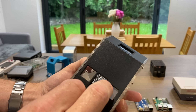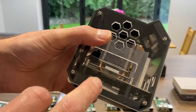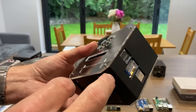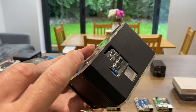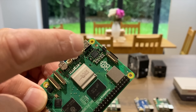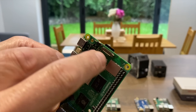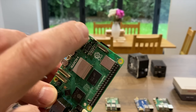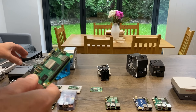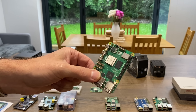Another 52pi case has the cut-out in the wrong place so it doesn't officially fit, but you could cut it since it's just plastic, and you can still use the M.2 drive in the bottom for fast storage. When using M.2 drives at the moment we're going through USB 3, which limits them a bit but is still fast. What we really want is the PCIe slot on the Pi 5, which will be great for NVMe and M.2 drives in the future. As of September 19th there isn't an adapter for this yet, but cases from Argon, 52pi, and Geekpi will likely support it in the future.